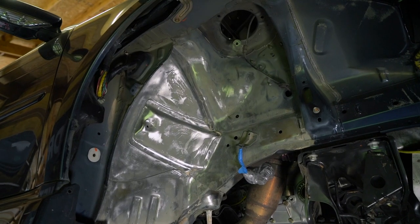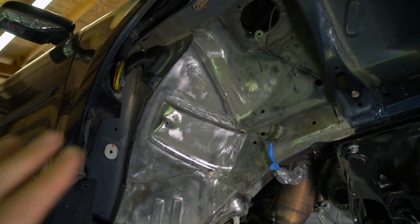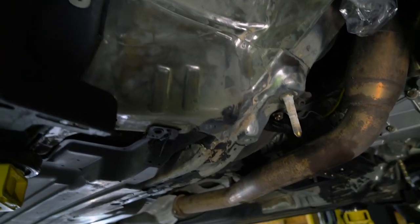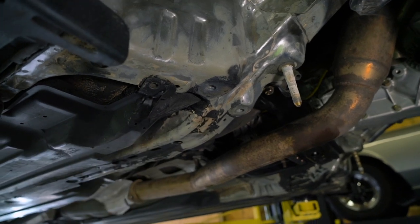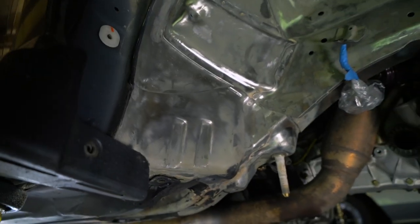It's been a few days since I picked up the camera because I had a super busy week at work and just couldn't get out to the garage as much as I'd hoped. When I did, I spent one full day and then like three days after work just prepping this car. Both wheel wells are about 90% prepped. I ended up removing all of what I thought was seam sealer because it was all just part of the undercoating, and to get a nice uniform look on both sides I stripped it down to the bare metal. We still need to scuff it and clean it with a wax and grease remover, and get this last bit cleaned up so we can get the surface primed and ready for the Raptor liner.